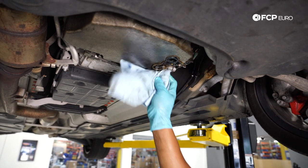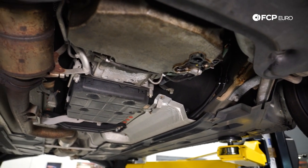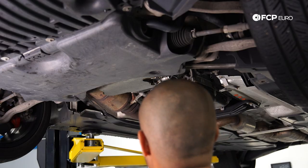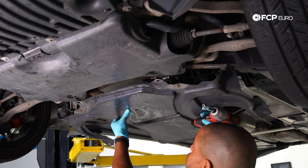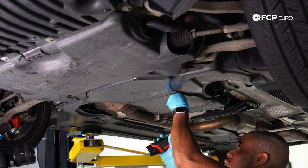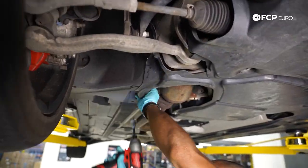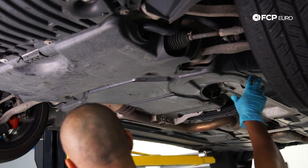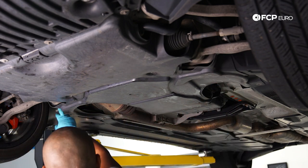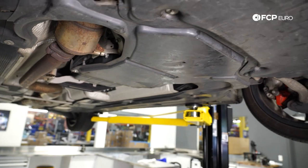We're going to clean that up so we can identify if there are leaks in the future. The pan is pretty soiled, so at some point we're going to have to diagnose what's going on here. But for today we're going to put the pan back on. This rearward shield needs to slide under the forward shield. I typically start from the back and just move forward. Normally you're going to have fasteners up front, over by the suspension arms at the two corners, and then in the transmission pan area.